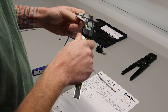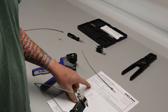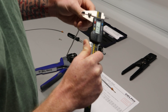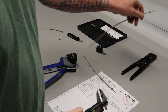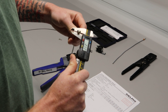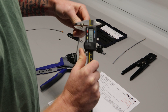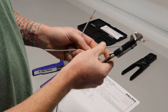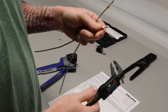For the first terminal we've got 2.11mm, and the core crimp height for 3.0 millimeters squared is supposed to be 2.10mm — so we are within one hundredth of a millimeter, well within the tolerance of five hundredths. Measuring the second terminal, it's right on at 2.11 as well. This tool crimped both terminals down to a hundredth of a millimeter in crimp height, and both times it crimped them the same.